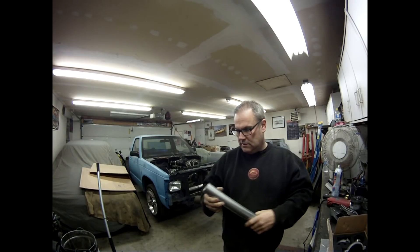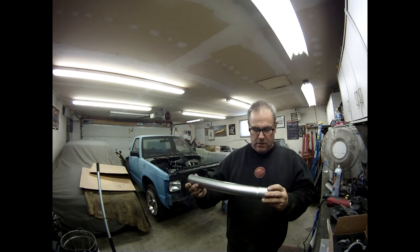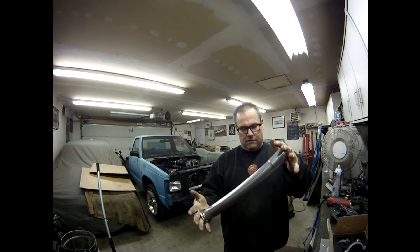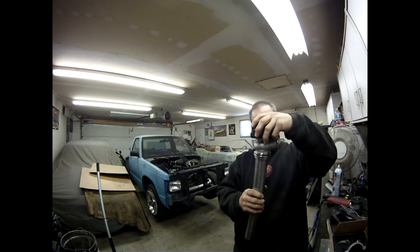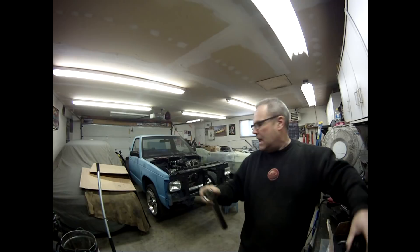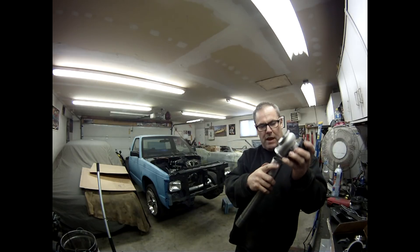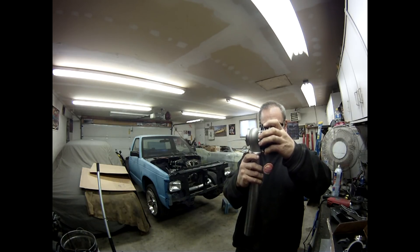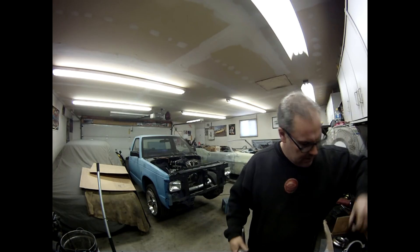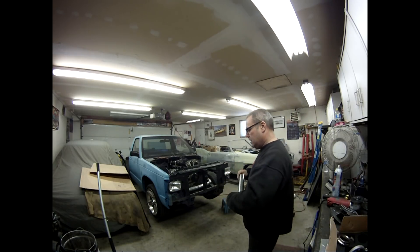This pipe is one and seven eighths. It was flared on one end because it's basically just a piece of exhaust pipe. So I cut that flared end off and now it fits perfectly in the V-band flange for the wastegate. Basically the wastegate just sits on there. If I put it down in the corner there, I can run the dump pipe — the exhaust pipe — down like this, because I'm not going to bother recirculating it into the exhaust. I don't care about the noise when the wastegate opens. I have it like that on my car and it's cool.